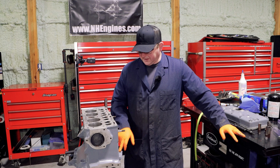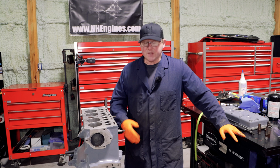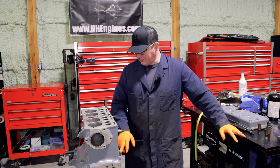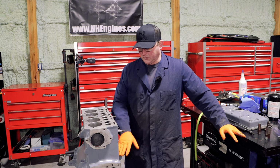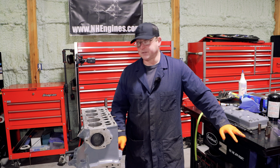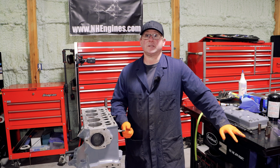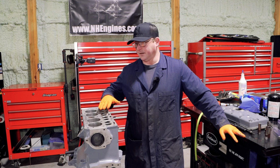So just doing it in this order, doing the ceramic enamel primer and then the ceramic enamel paint, means that any oil that I've got here will just go over my finished surface. And if I scratch it or mess it up, even though this is pretty tough, I can touch it up super easy, but I'm not dealing with that whole oil impregnation thing a second time.